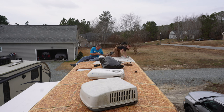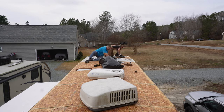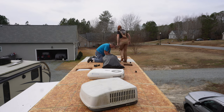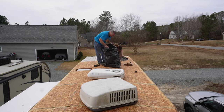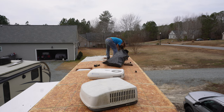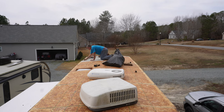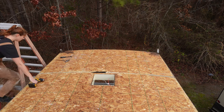Just inch by inch, moving it along. I moved the AC units down a little and that's totally fine — just be careful not to pinch any wires underneath. This is also a really good time to replace the gaskets on your AC units if they're older. You can buy them off Amazon for about 20 bucks — just scrape the old gasket off, clean it well with alcohol, and apply a new gasket. I definitely recommend that if you haven't done it in the last five years, because the foam gets worn out and that's one more place you could have a leak.